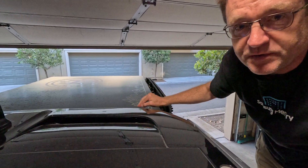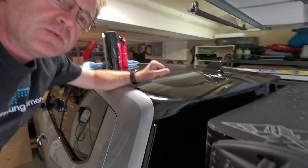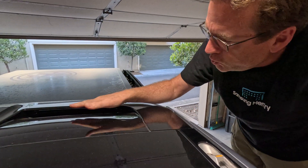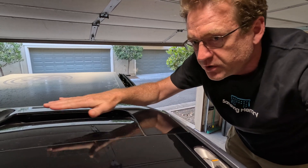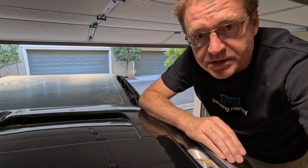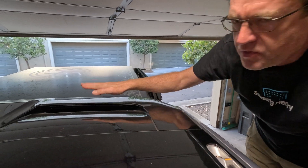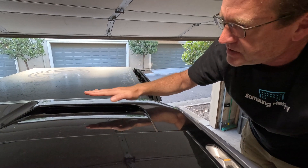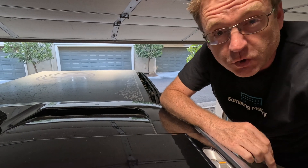When we put on this rooftop tent, we cause problems because this little hole pulls airflow down from the top of the roof. Essentially what it's doing is breaking up the vacuum behind the cab of the truck. As it moves along the road, that vacuum sucks the truck backwards. This cool duct directs airflow down to break up that vacuum without increasing the frontal area at all — a pretty neat trick. Although you could also just not have it and let the whole roof curve down more gradually. It certainly wouldn't look as cool, that's for sure.